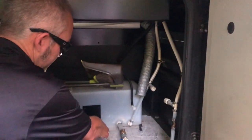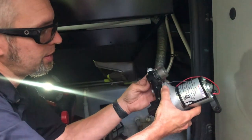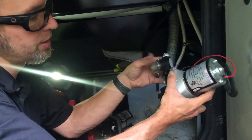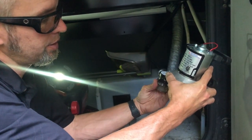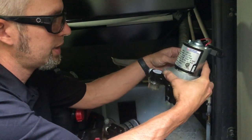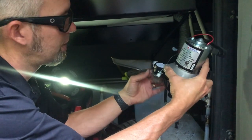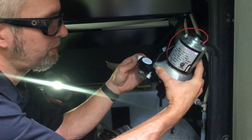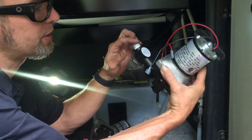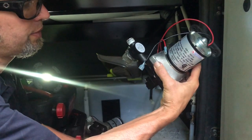I'll put this back on the pump we just cleaned. You can use some Teflon tape on there, but it will seal itself inside there — you don't really need to crank on it. Just hand tight has been sufficient for us. Now someone had put Teflon tape on the inlet of this before, but this isn't where it's sealing. The seal is actually an O-ring that fits around this side of that fitting, so it doesn't even really need to be on there.